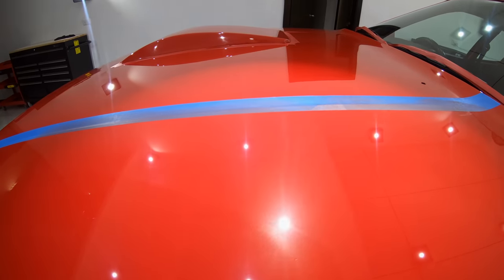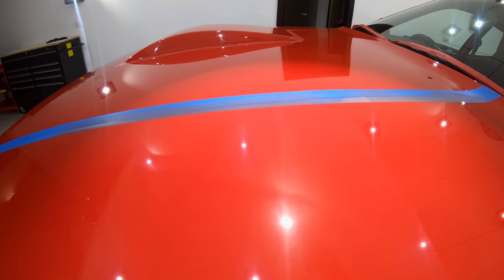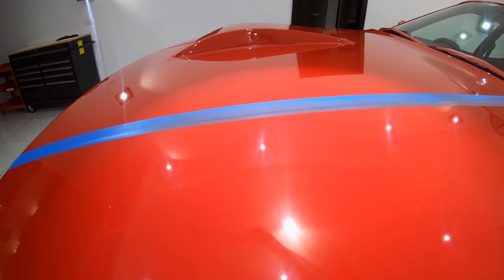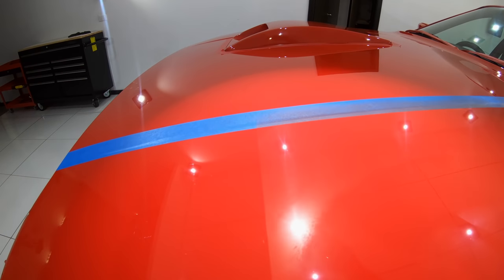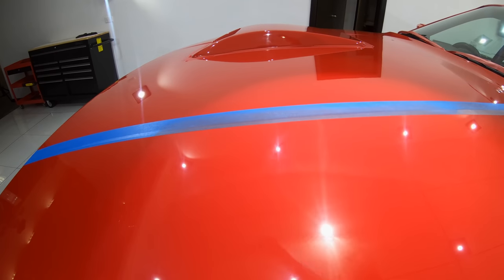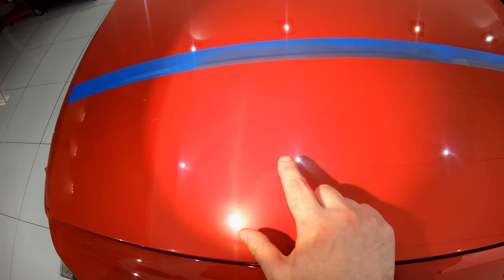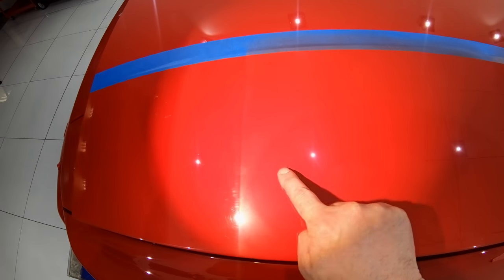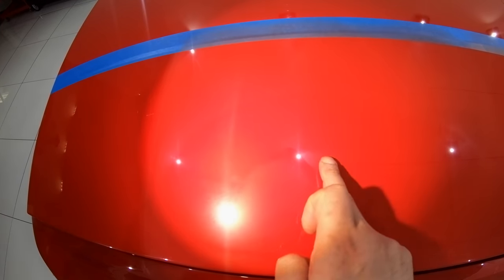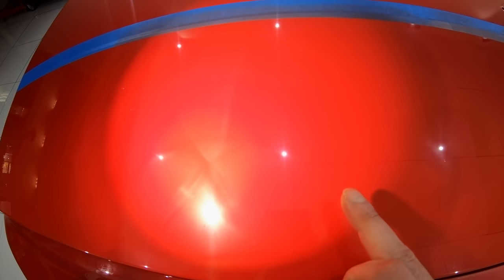Now, not as I'd hoped, but more as I predicted, the microfiber pad was a complete disaster on this soft and sensitive paint. But I also think that from a sharing perspective, it's easier for me to show you guys why microfiber pads and soft paints don't tend to mix well. The haze in the finish is just off the scale, as is the patchy and inconsistent finish, which is more or less the paint speaking to you and saying, "I don't like this at all."